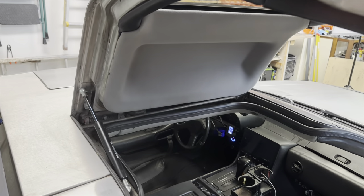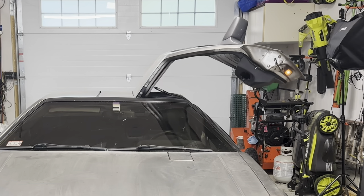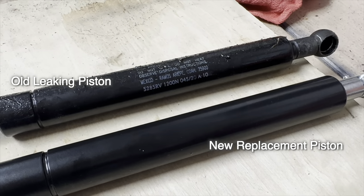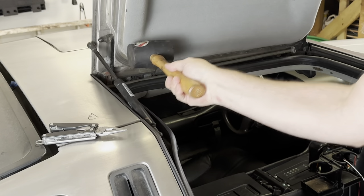These pistons don't actually open the doors — that's what the torsion bars are for. These are mostly just to keep them open. Unfortunately, they only seem to last a couple of years before the doors start to sag and I have to replace them. The good news is that they're easy to get and fairly easy to replace. And that's when you find out just how heavy these doors are. I'll prop it open with a 2x4 and try to keep my shoulder under the door just to reduce the chance of anything going wrong and crushing my fingers.